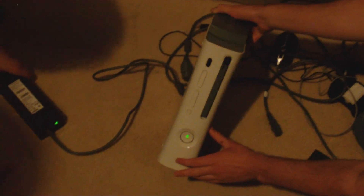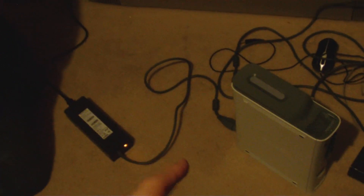As you can see, this power brick is yellow. I'm going to turn on my 360 - red ring of death automatically appears. Now I'll swap in my friend's Xbox 360 Elite grounding cable with the same style power brick. Connect it here - this one is also yellow. Now look at my 360 which had the red ring of death - it works! The CD drive doesn't work, but everything else is fine. So just a reminder: it may be your power brick causing the red ring of death, not your Xbox. Test your power brick on a friend's console. Good day.